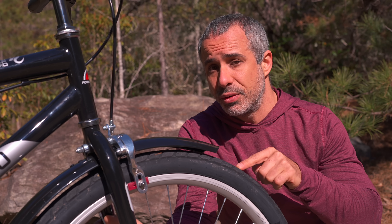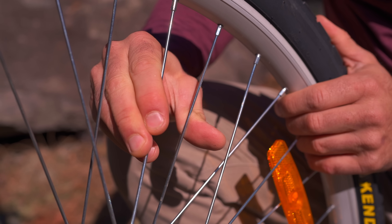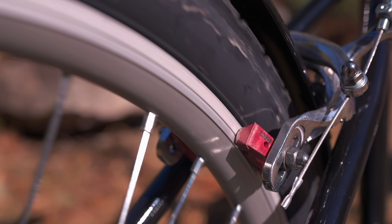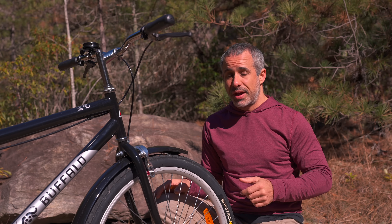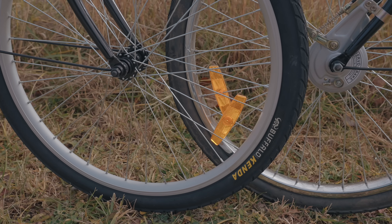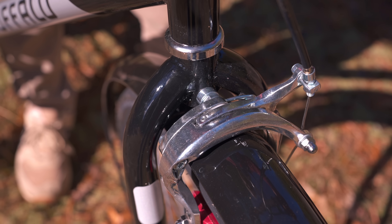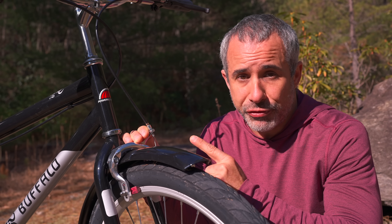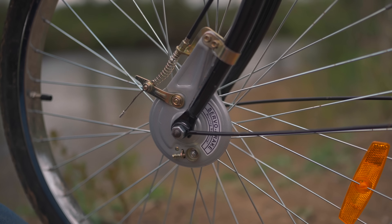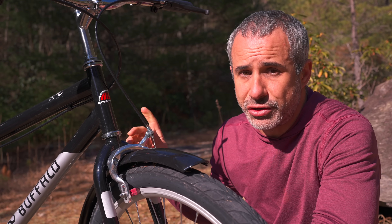So they had to do something different on the Buffalo S2. Most bicycle wheels can be trued — truing involves adjusting the tension of spokes to bring the wheel back into alignment. The old Buffalo could be trued, it was just really difficult. They made it a lot easier on this one by using box-section aluminum rims, which are plenty robust, a little bit lighter weight, and a lot easier to true. There are any number of brakes they could have chosen, but I was not expecting dual-pivot caliper brakes. These are pretty easy to work on and provide a lot of braking power — I'm just surprised they were able to get ones that were so inexpensive. These are more finicky than coaster brakes, but they're easier to service than the drum brake that was on the front of the old Buffalo, and they're a fair trade-off for this unique shifting mechanism.